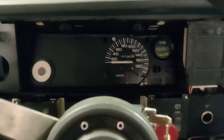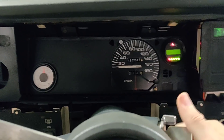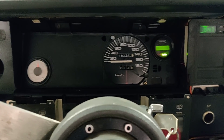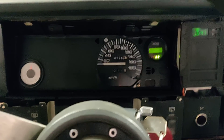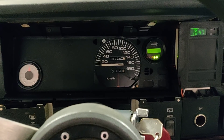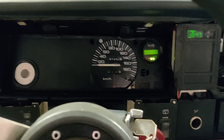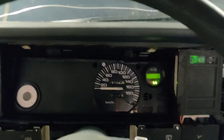We're just going to start this up and show you what it's like. It's actually not very exciting — it doesn't make a lot of noise, which is kind of the point. You just turn the key to start. There's no ignition, no starter motor — you're just sort of turning it on. You'll see the gauges light up. You'll hear a little bit of a hum there — that's just the vacuum pump getting up to speed. Shortly that's going to turn off, and that's the noise it's normally going to make. I'll just rev the engine here a little bit. It's not super loud — it sounds almost like a blender, just a really big version of that. You'll also notice I can do this inside my garage and not kill myself, because I'm not putting out any emissions.